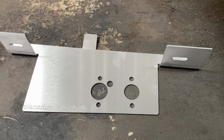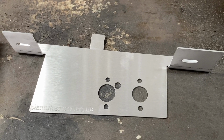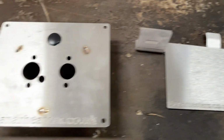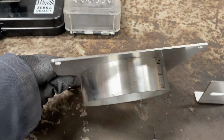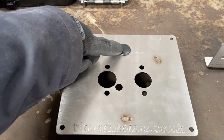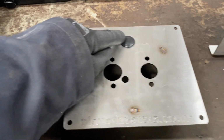So Volkswagen T5 mounting. This is the specific one for mounting underneath, underslung as everybody calls it. And here we have a turret plate that you can see that we supply, which the heater mounts on, and that can go under the driver's seat, which is the most recommended place. Note there's a grommet for the fuel pump wire to go through as well.